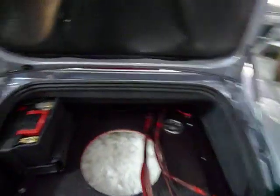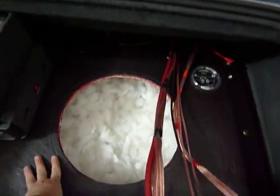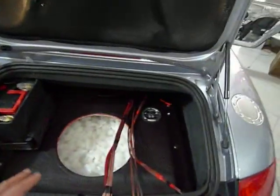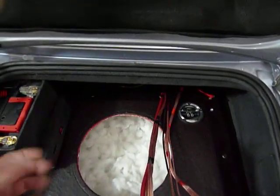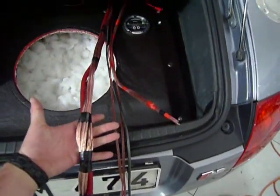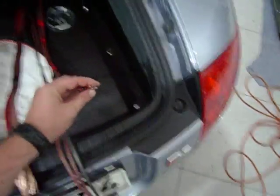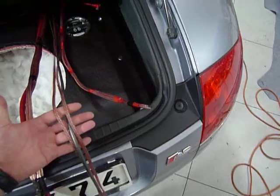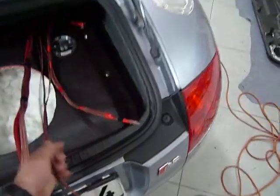In the back, Julian's built a custom box which is going in here. You can see this is wadded out, and what this does is in the small box it fools the subwoofer into thinking it's in a much bigger box, giving you a much deeper bass response. There's a second battery of course, and this is the cabling — quite a lot as you can see. We're using 4mm for every speaker in the car, and Stinger RCAs — really high quality RCA leads front to back.